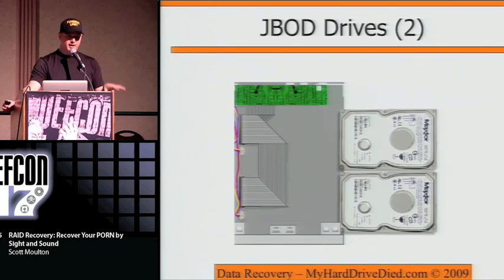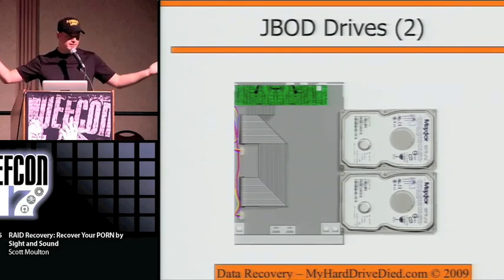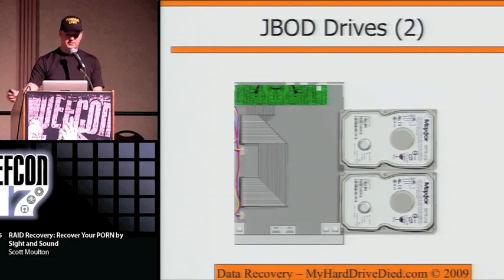The other disk is going to have the file system and sometimes have what's called an HPA — a host-protected area — and it will be the size of the two drives together. So if these are two 250GB drives that together make 500GB, the first drive will have an HPA saying 'I am 500 gigs.' You plug in this 250GB drive and it says it's 500. That tells you right away what you're dealing with, which one you have, and since it's the first one, the second disk is dead. You still have the file system and can likely fix the files on that one disk.